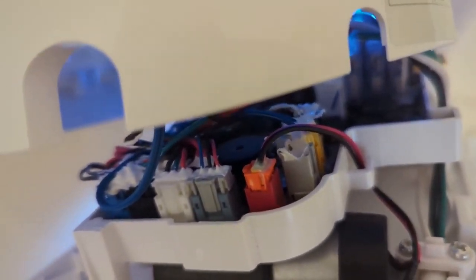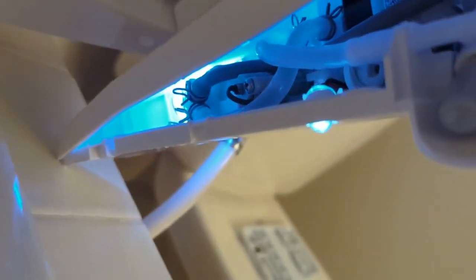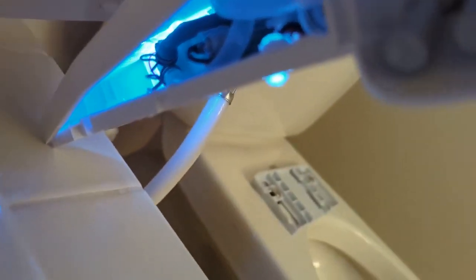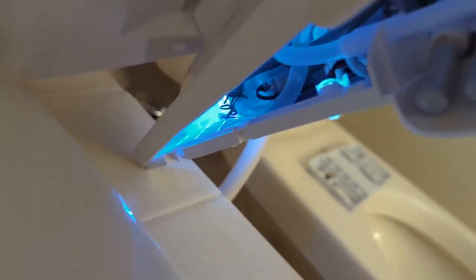Okay, there's your culprit. That little circle-looking thing — I've got it right in the center of the screen. I can't hold it because I'm holding the case open with my hand. You don't want to pry this open too far because down here you're connected — inside there, near the light, that switch, the handle that turns it on, it's kind of stuck in there and I didn't want to disassemble all that. But there's your chirper: that little circle black disc with the hole in it, like a big fat black donut.